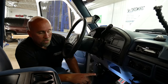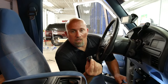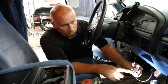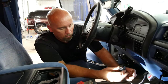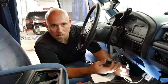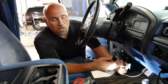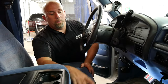His truck already has switches right here, so we're going to pop one out and repurpose it. Make sure you run your wire through the hole before connecting the switch. On this switch it's actually labeled: positive, light, and ground. On your harness your red is positive, black is ground, and blue goes to your light. Now, a lot of people already have upfitter switches or their own switches — if you need to cut this plug off, that's not going to void your warranty, just make sure you wire it back up correctly. Now let's go hook it up to the battery.